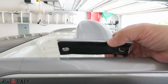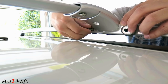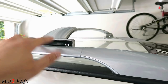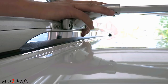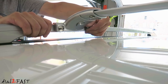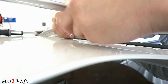Here I've placed a plastic piece onto the surface of the crossbar, placed it down onto the roof rail, and then loosely installed the two screws. Install a washer on each screw. As I'm fitting the other side in, this is a very tight fit to get it to fit between the two rails, so I'm having to push this in. Install the two screws and washer. Once you have all the screws installed, you can go ahead and tighten them. Don't forget to tighten the ones underneath.